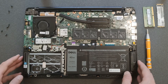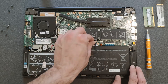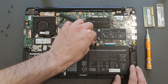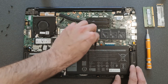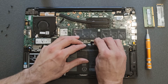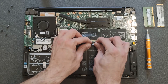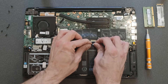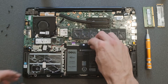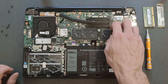The first thing I recommend you do is disconnect your battery before you change your RAM sticks or disconnect your solid state drive. In my case there was a bit of resistance — there's some black tape on top of that connection — so just loosen that tape first, then disconnect the battery itself. Take your time, there's no panic, just don't break anything.